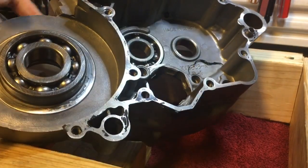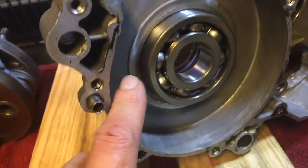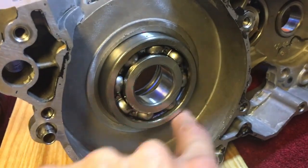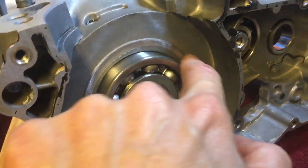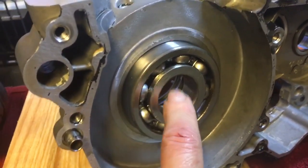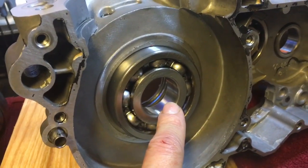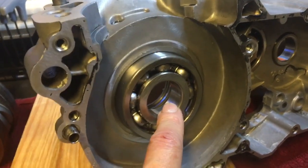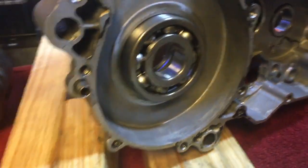If this happens, you reach out to somebody named Tom Morgan - Tom Morgan Racing. Many of you have probably heard of him on the different boards and groups. What Tom Morgan actually does is he goes in and puts a new journal on the crank so that the bearing will fit tight. The issue is that the journal is worn out. Tom is a former Kawasaki R&D guy and a former factory mechanic for riders like Jeff Ward.